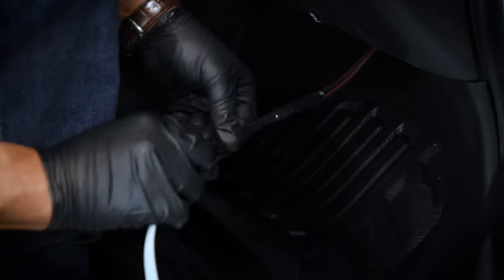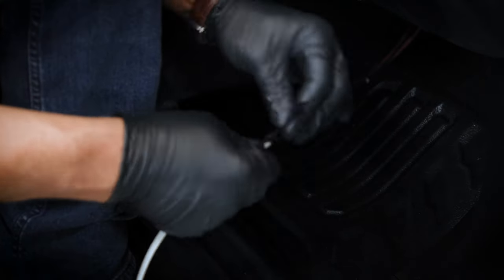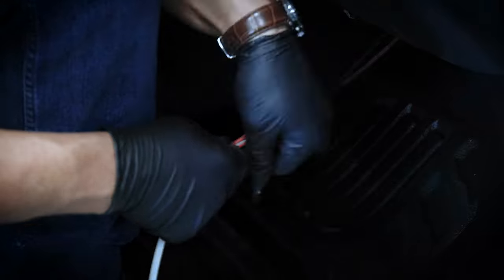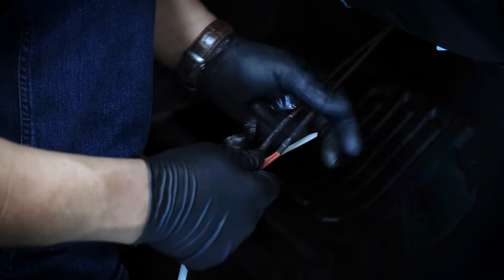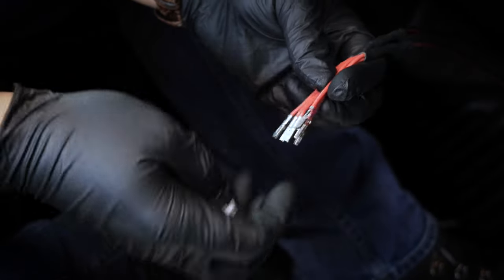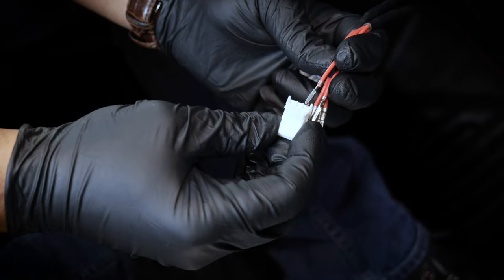Our zip tie is exposed right here underneath our glove box area. If your zip tie didn't pop free down here or wasn't visible when you pushed it through, just reach your hand right up in there and you'll feel the back side of that grommet — it'll probably be curled up around there somewhere and you can just pull that out. We'll pull our wire through and here you can see we have the end of our wires. I'll go ahead and remove the tape, and now we can attach the connectors.